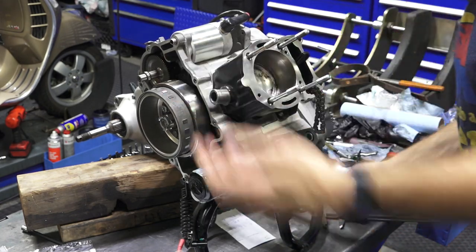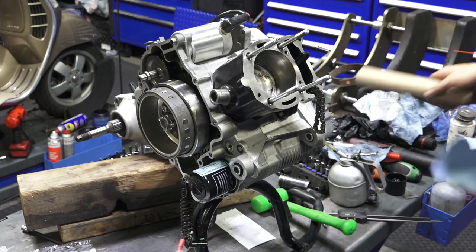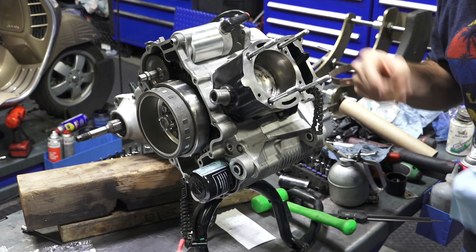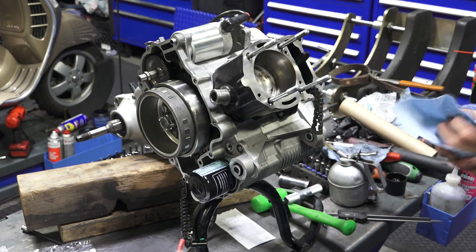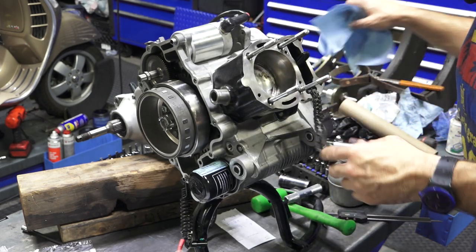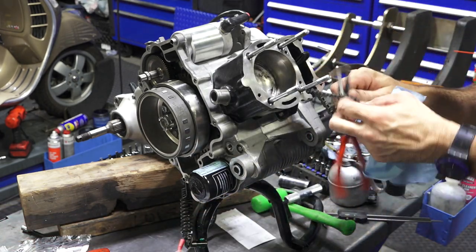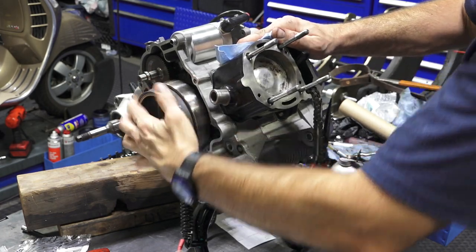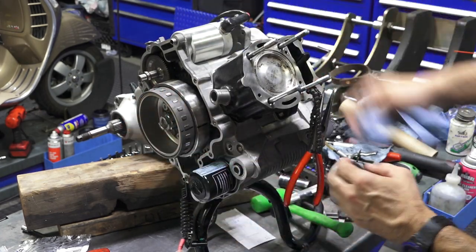the cylinder. And one thing, I stated that the piston is matched to the cylinder, but there's not oversizes available. On the top of the crown of the piston is a zero, or an O, and then engraved in the top of the cylinder is a zero as well. And that just indicates that the clearance for both the piston and the cylinder have been determined by the manufacturer when they checked all the tolerances. So now I'm gonna bring this back to top dead center, and I got my mark. It's pretty close right there.